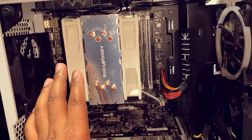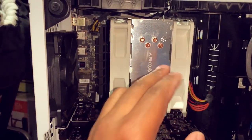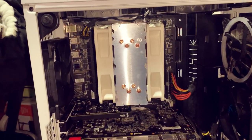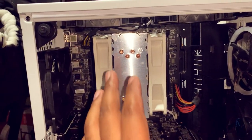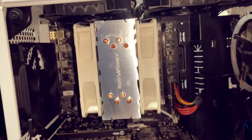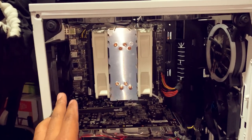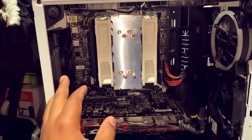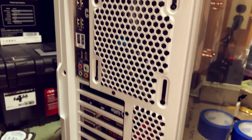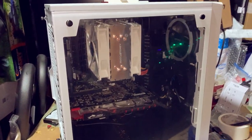This particular motherboard only has three locations for a fan. One being for the CPU, and then two being for case fans. So our motherboard's fan ports are maxed out. Fortunately, these two fans have the connectors so that way it can receive power directly from the power supply. So the actual two fans that come with this case have a 3-pin connector, which you will typically install to your motherboard. Here you go. She is all set up and ready to go.